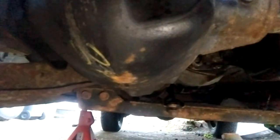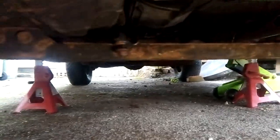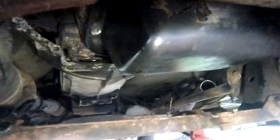This is coming out. You can see the oil sump here, which is hitting that front differential. Once this rail comes out, this brace, I can get to all of the bolts that hold the sump in, and that's the plan. Remove the sump, the oil pickup comes right down to the bottom of this sump, which doesn't get me any further forward for all the effort, but the sump is on gas pipe size pipe, I guess. It's like a trumpet. It won't unbolt, so I'm just going to cut the thing off, which should enable me to just lift the engine straight out.